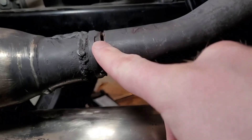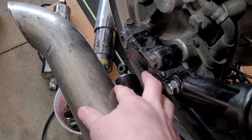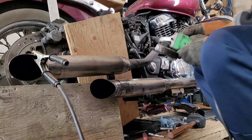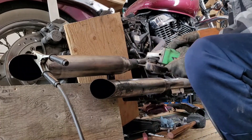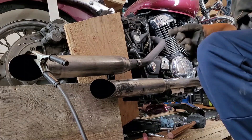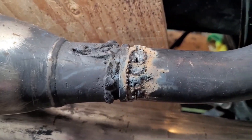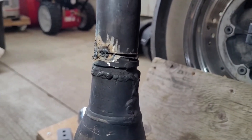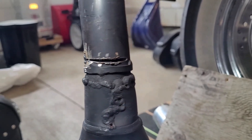It's the next day — I went ahead and made my cut right there. It's a little more open than what I was hoping for, but I should be able to make it work. It pulled the exhaust away from the swing arm a little bit more and closed the gap between the two brackets. I'll go ahead, grab the welder, and get it tacked up. I got the top of it kind of tacked, so hopefully it doesn't come apart. I'm not a certified welder — I just do it for fun. You can definitely see how much it pulled itself in after I cut it and bolted it down.